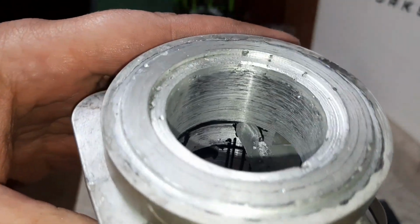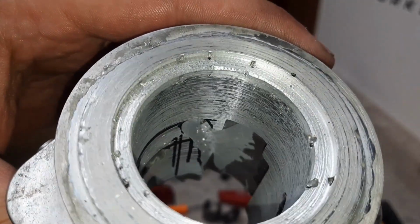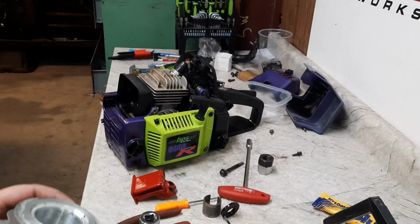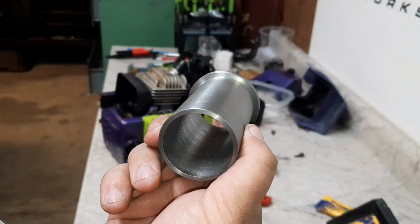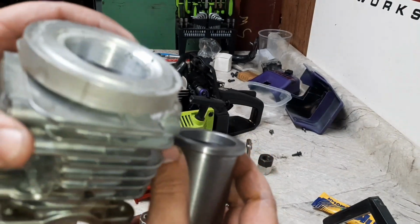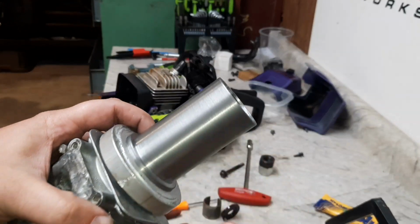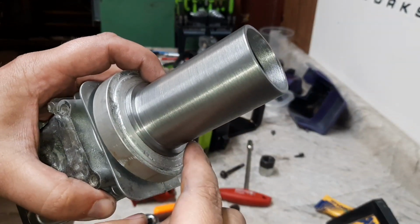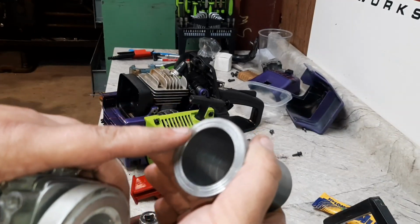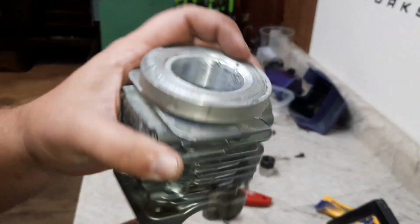There's the other cylinder. Same thing. Nice and porous. But some large deep fingers. This one's just going to be a single exhaust port. And I machined a pair of sleeves. These have the step at the top so they don't fall all the way through. And they'll fit right in. Once they're in, I can machine off the top and it'll actually seal on this surface of the sleeve here. Get these put in the oven and installed.